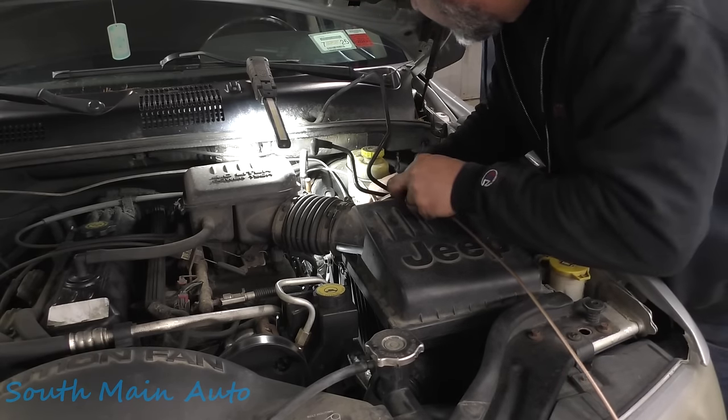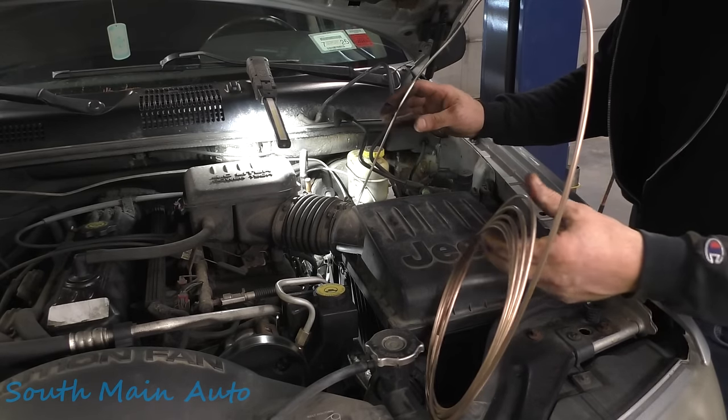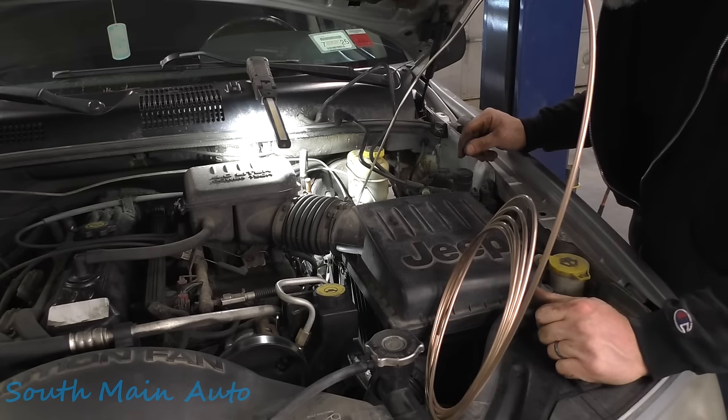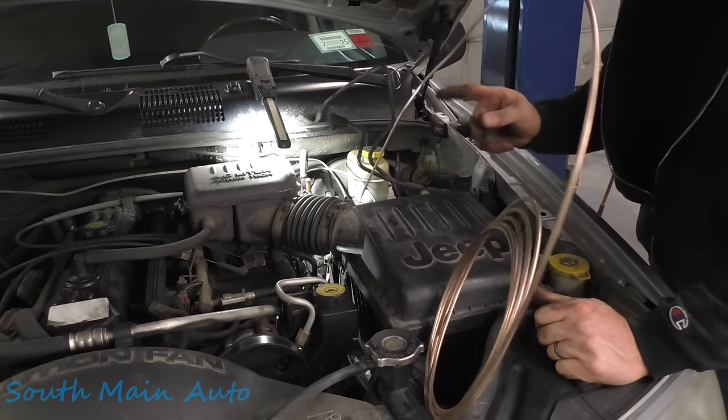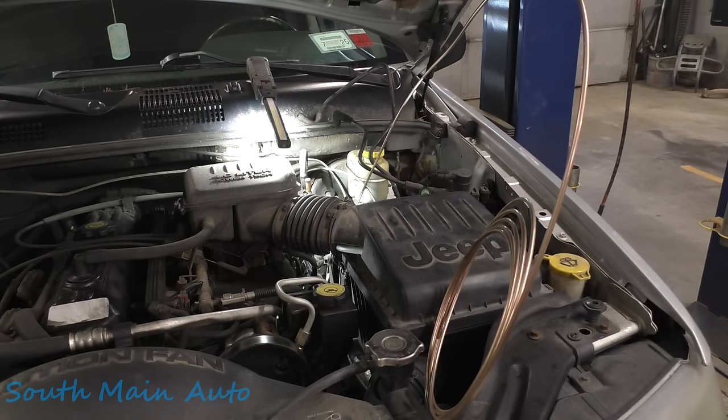Down around the steering shaft, and we're down at the bottom. We're gonna leave our loop right here, and we're gonna go down underneath, hook it up, and then start manipulating it as we come up through, and then we'll guesstimate how much we need. We'll chop it off up here, and then make our bubble flare, and be done with it. Move on with life.